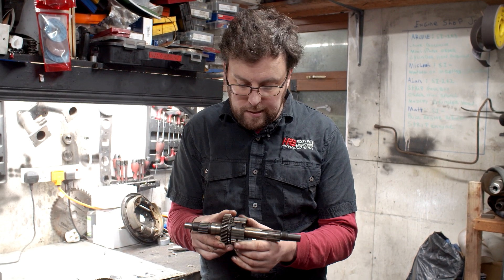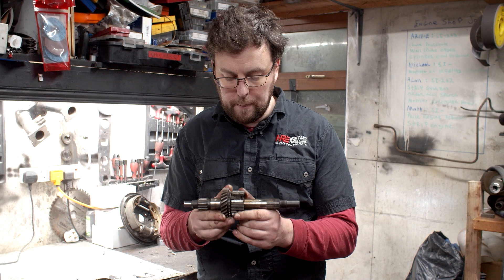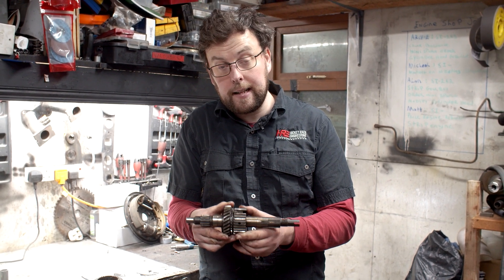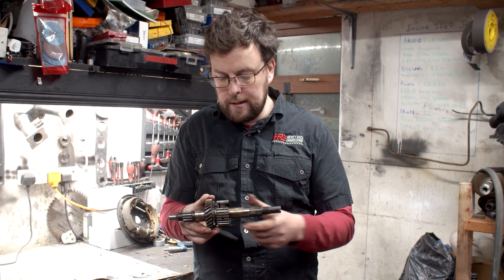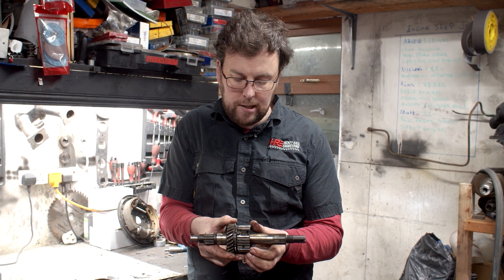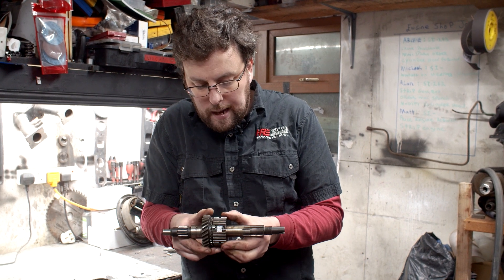What's now happened is I have a driving force there. That balk ring is now wedged and as it tries to turn it's now turning the two of these together. There can still be some slip but it's very little — we've reduced it greatly. So what happens is: the wheels are spinning, we disengage one gear, so more than likely our synchro hub is going to be that way in first gear, and then we try and engage second — but just before second slides in it pushes that synchro hub up there onto that cone and brings those two together.